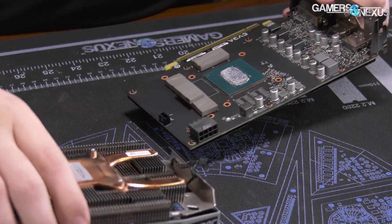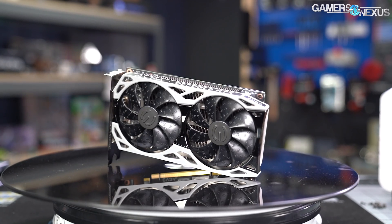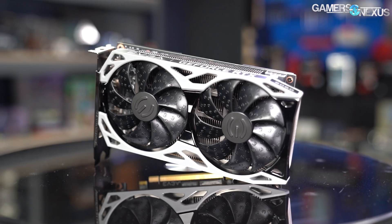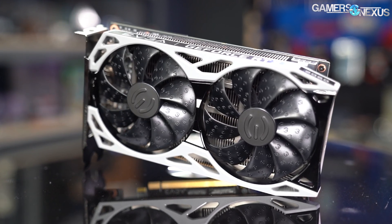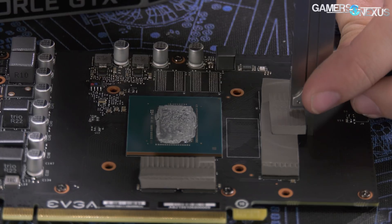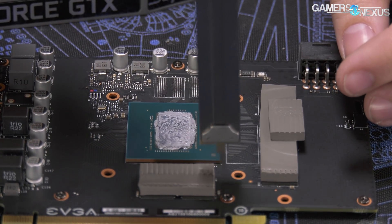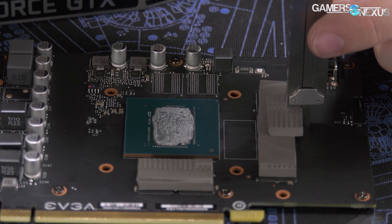Following our interesting discoveries of the RTX 2060 KO — the card which features a fused-down RTX 2080 die wherein Nvidia accidentally forgot to turn a few things off — we wanted to look more into the actual quality of the 1660 Super cooler that was tossed onto a higher-end GPU. In this benchmark we'll be focusing almost entirely on GDDR6 thermals for components under those nine millimeter thermal pads, or rather two of them stacked. We'll also look at noise numbers and the v-BIOS default profiles and temperature targets — to determine whether EVGA used peppermint or spearmint thermal pads and for how long they were pre-chewed prior to application.